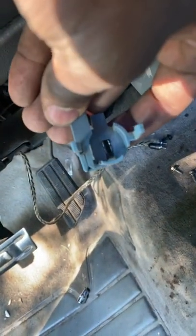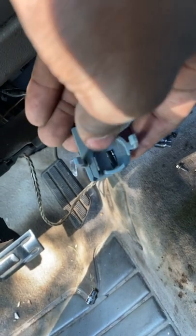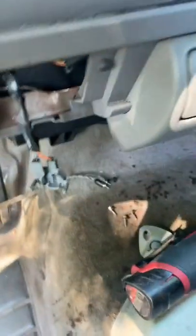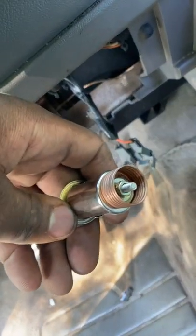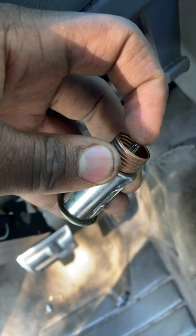What's going on y'all — this is a '93 Chevy Silverado. If your cigarette lighter doesn't work and the fuse is not the problem, then there's a good chance it's in the back of the cigarette lighter. That little pin right there — the gap is too big, and it's causing this not to get a good connection. The deal in the middle right here.